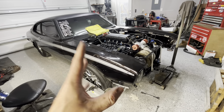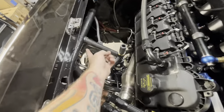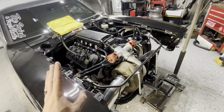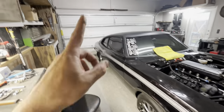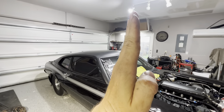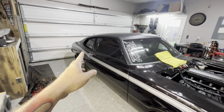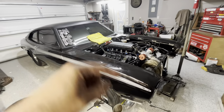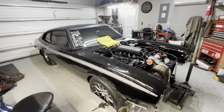That's basically everything in our front end. All we need to do now — which I'm not going to film — is weld up our travel limiters. I have the chains dangling, they just need to be welded, then I'll pull the wheels back off, grind the paint, weld them up, and repaint. I need to snug down all the suspension bolts, then put the grille, bumper, and valence back on — and the front end is done. Next video we're moving on to the rear end: changing the shock mounting location, doing the anti-roll bar links, double-checking all rear end nuts and bolts, and then this car will be ready to go to TKM Performance for the dyno. Make sure you stay tuned, smash the notification button, and I'll catch you all in the next one.